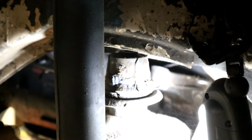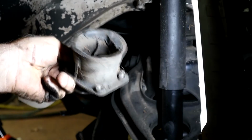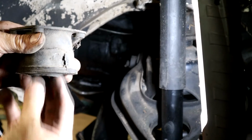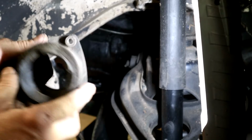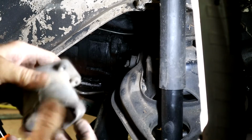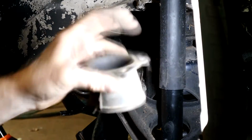Just see now, what I want to show you. This, okay, so that's what I was talking about. See, that mount's just come apart. I have to get that other bit out of there, but you can see all that stress, hanging these front ends, the engine and everything hanging on these subframe mounts. Admittedly, there are other things connecting them, but you can see what stress they're put under, and that's why I think the locking plates are a good idea.